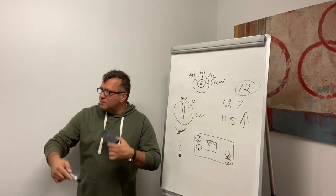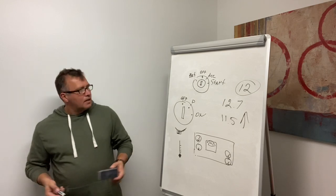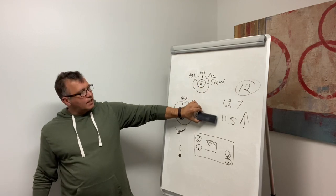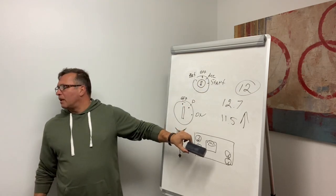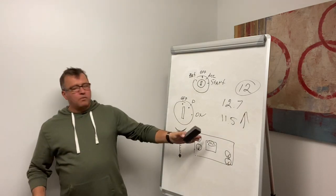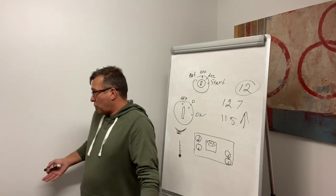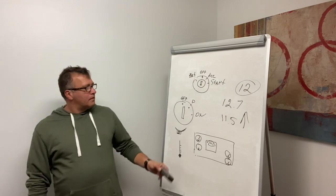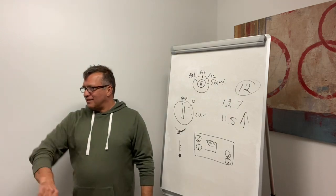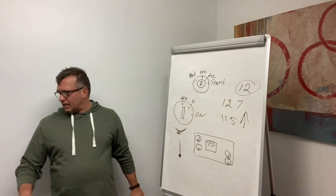I'm explaining how it works because probably we'll need to explain it to the examiner. Okay? So, cold engine, 12.7, after start, 11.5, 5 seconds, 14.1. My alternator is charging, working properly. My voltage is rising, which indicates my alternator is charging. If it stays at 11.5 and keeps dropping, you're in trouble. Can we see the 11.5 on the dashboard? Yes.